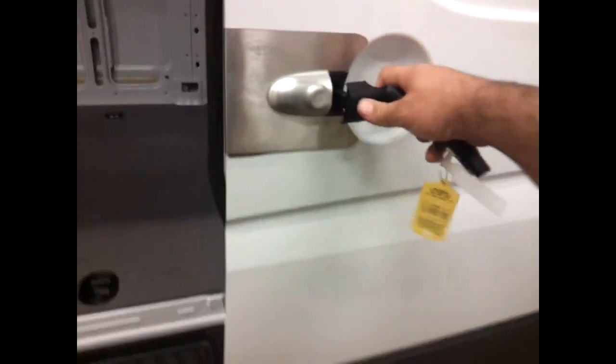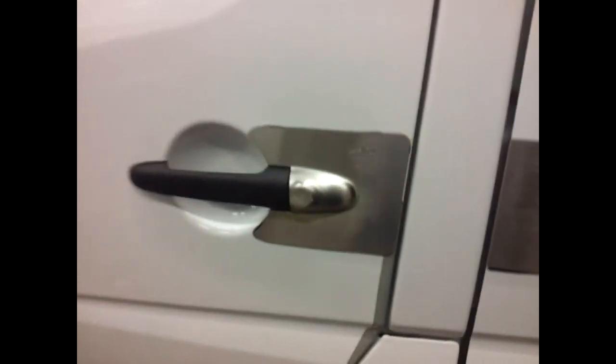Here's the side load door security. Again, armor plate at the front, and we've got the deadlock along the trailing edge of the door. There's also a reinforcement plate behind the deadlock, and on this particular deadlock I've gone with a long-throw bolt, so it's nice and deep into the recess of the door and behind the bracket. There's also an additional plate inside this door that you can't see, and I'm not going to say where. I've got respect for the tradesmen that have got these vehicles, and although the wrong people probably do know about it already, I don't want to be the one to tell them if they don't.